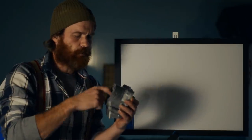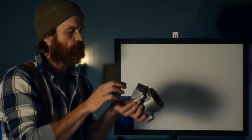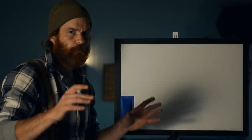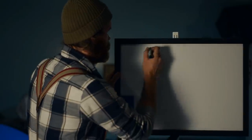First up, the exhaust port and duct. The exhaust port is kind of simple compared to the transfers. The goal here is to maximize port area and maximize duct velocity and flow through the duct. First, a few constraints you have to work with when designing an exhaust port.